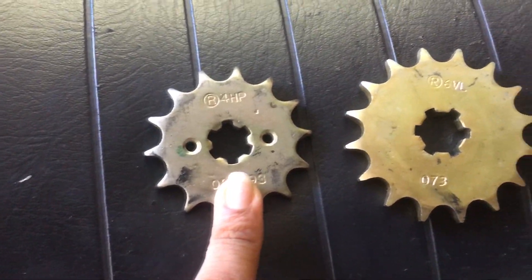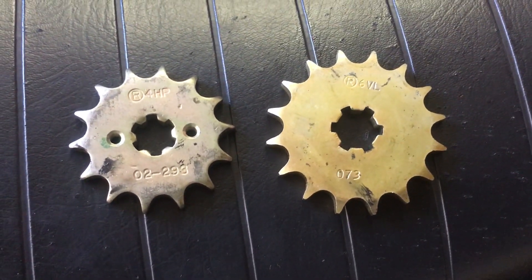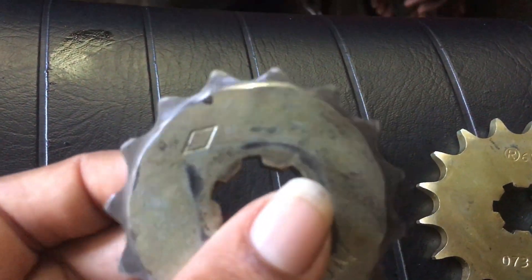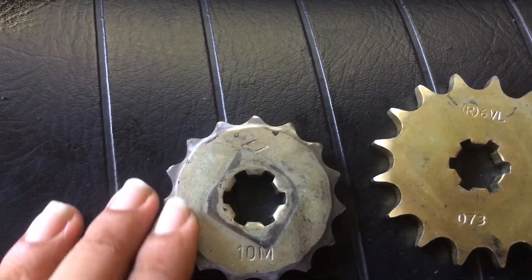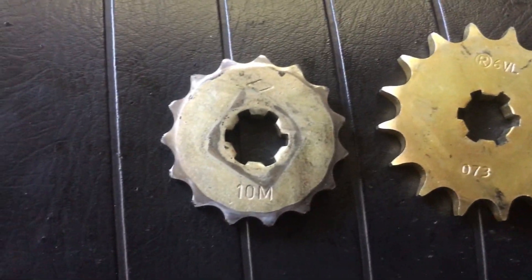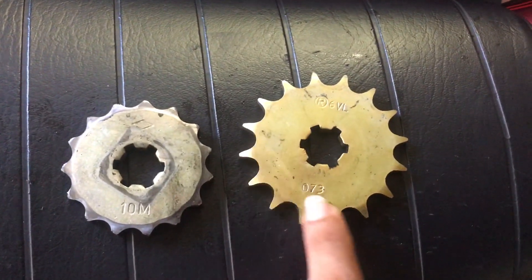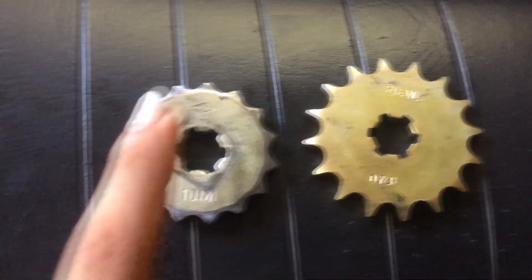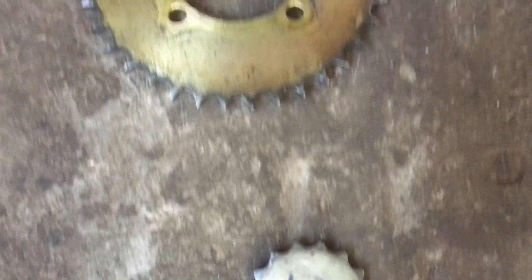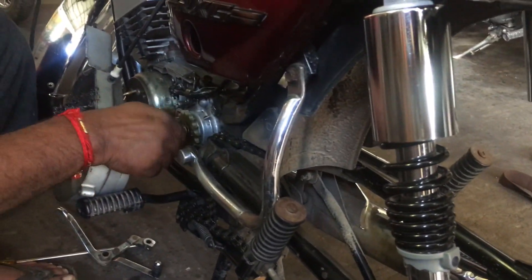So we can't use this 14 teeth, but I will keep experimenting. For now we will just use the 16 teeth one. This is the front sprocket — this is the 15 teeth one — as you guys can see, it's completely worn out. This is actually the problem here because the rear sprocket was okay, but the front was completely worn out, and that is why it was stuttering as you guys heard when the bike was being loaded up the ramp. This is the old one, this is the new one — you guys can see the difference. This one is made by Diamond, this is by Roll-On. The old setup was 15 teeth front and 37 at the back, the new one is 34 teeth at the back and 16 teeth at the front.